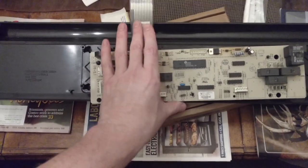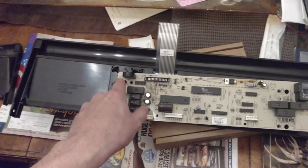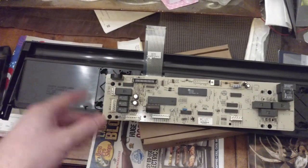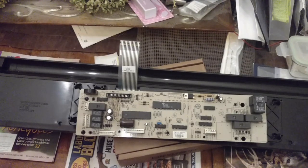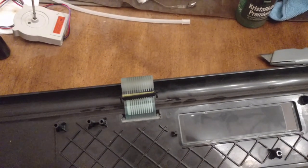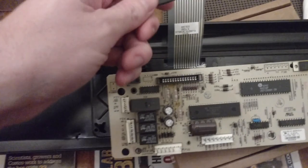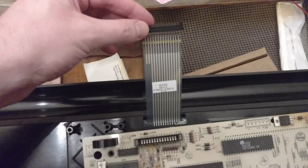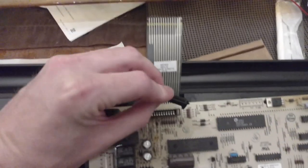All we've got to do is connect everything back on those cables, put the ribbon part into here, and put the screws back on to attach this to the keypad — which is five Phillips head screws, pretty easy. You will also need the little connector part from the old one — just put it up here on the new one, and that's what actually snaps into place.